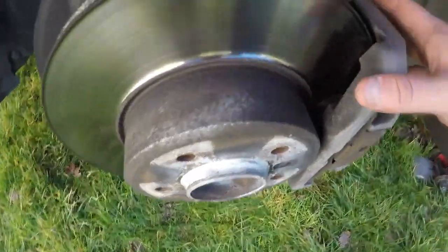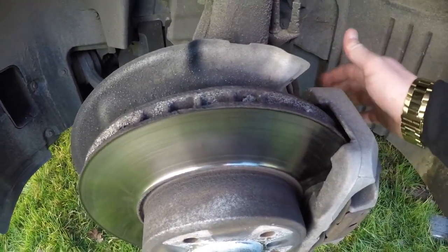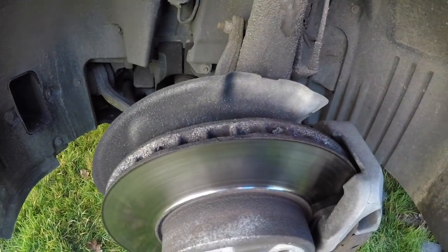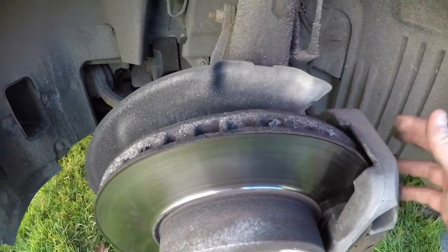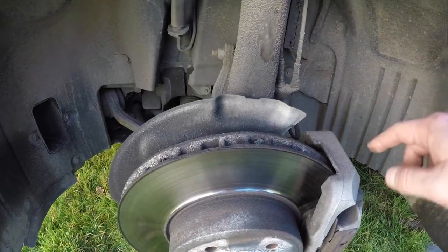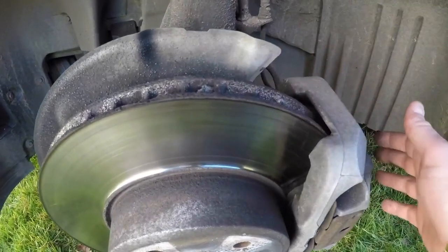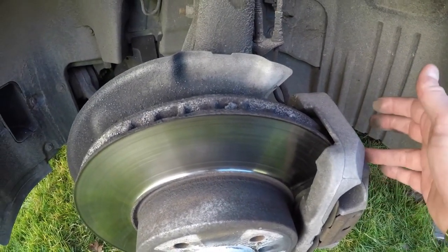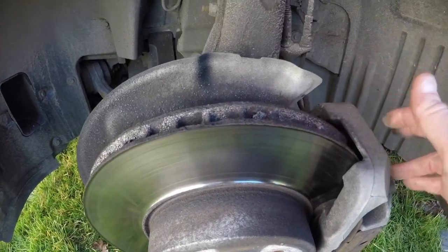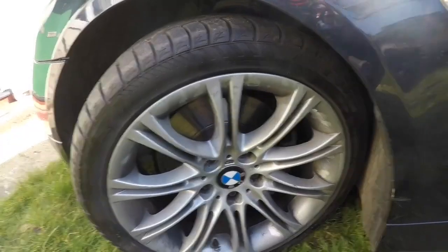Before you remove the front caliper, turn the steering wheel towards the caliper side so you can see the bolts — on a UK car that's the driver's side, in America it would be the passenger side. You want the caliper oriented so the bolts sit behind it. They should still be a 7mm allen bolt. Remove the bolt caps, remove the bolts, and the caliper comes off. Then take off the carrier as well, and the disc will come off too.